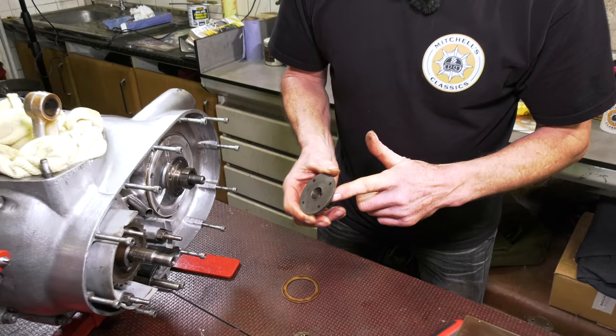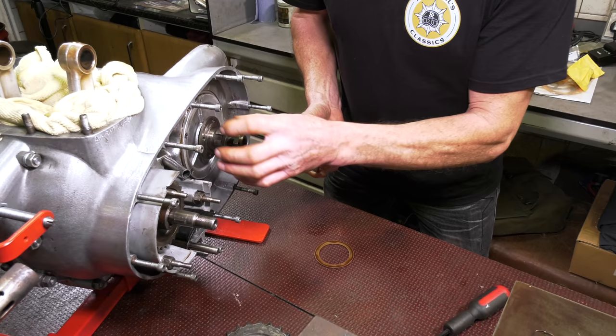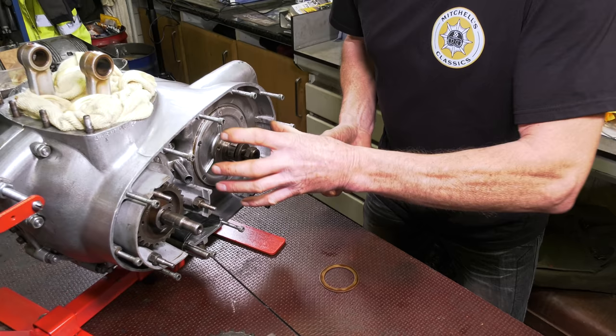What we're going to do before this is put our pistons on and get the barrels built back up, then we'll put the clutch together. But I just wanted to show you — always make sure that isn't worn before you put it back on. Because if your center nut on your clutch was a little bit loose, there's a good chance that key has been chattering in that center, and you might find the whole clutch was wobbling about quite a bit. So always check the condition of that clutch center.